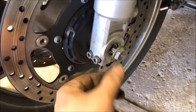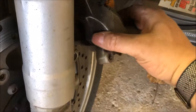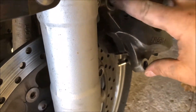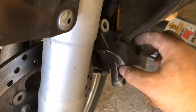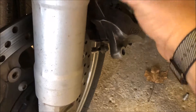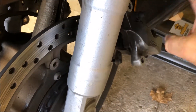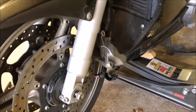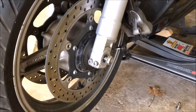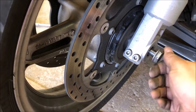Now you see I have the anti-lock brake sensor removed, the caliper removed, these are loosened up, and calipers are removed on the other side. Remember when you take this caliper off it's a tight fit back there — if you twist it a little bit to push the piston in, it gives you a little bit more room, then you can pull it out off the top. Do that on both sides. Also, since you're compressing the piston, remember when you put it back on to squeeze the brake a couple of times to fill that cylinder back up again so you don't lose your brakes.